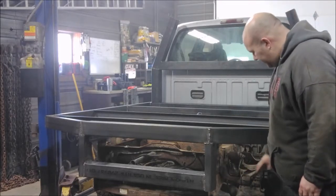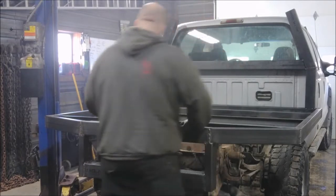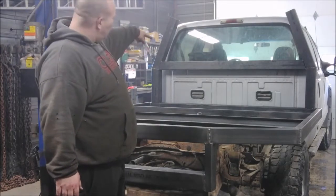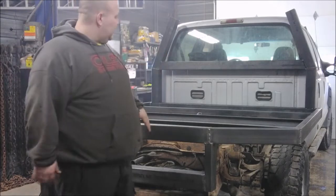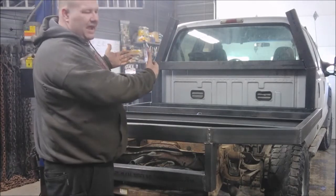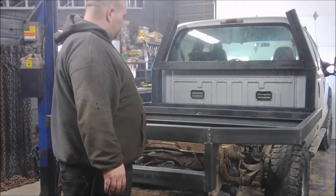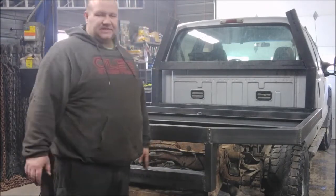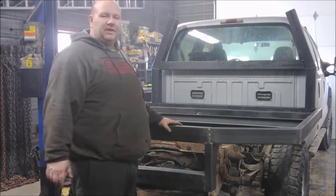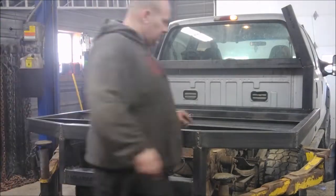We're going to add some skirting along here, like a skirt from here to here, this will get filled in, license plate, two big badass backup lights. What we're doing next is we're getting ready to lift this thing off with a hoist, because I only did a couple of spot welds up in that front corner — that's where the gas tank is, so we don't want it to go boom. We're going to lift the bed off, pull the truck out, and then finish welding that corner and the back side of the headache rack. The metal is supposed to be in on Monday — it's Saturday today. Then we're going to have them shear us some pieces for the skirting instead of trying to cut it out. Once we get that all done, put the deck on, I'm going to try and flip this thing upside down so I can weld everything from the bottom instead of trying to weld overhead. Let's get to lifting this thing off.